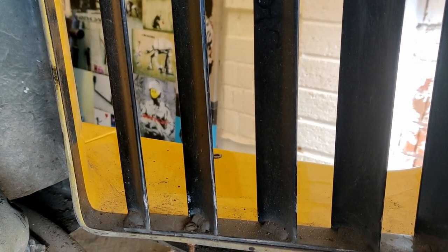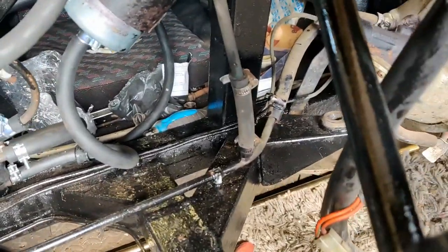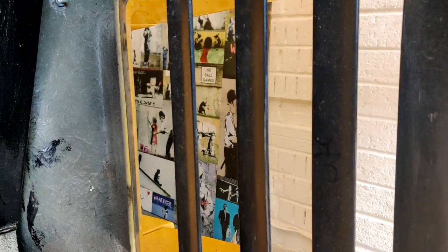What I've got to do is take these vents off, move them forward by about 15-20mm, and cut the back of the fibreglass off. I forgot that when I modified mine to the bigger more powerful radiators they were wider. So I've just struggled like a divvy and obviously forgot all about it. In the meantime I've replaced all of the fuel hoses. I've just spent probably two or three hours messing around with this and then realised it's not going to work. Because it's so old I'm going to have to cut these bolts off because they won't come off. A couple of minutes with the angle grinder and I'll mark it and cut it all off.